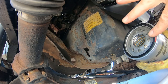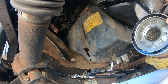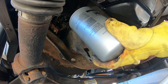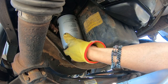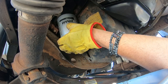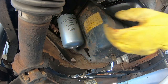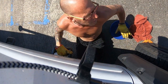The first thing you do with a new oil filter — you grab some of the old oil on your finger and you lube up the gasket right here, so it makes a nice seal. There we go. Once the seal is all lubed up, we'll just spin it on — righty-tighty — not too tight, just hand-tightened. There we go. That's everything I need to do under the truck.